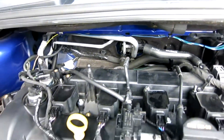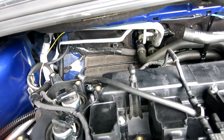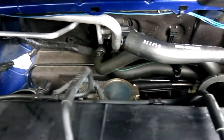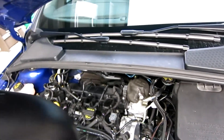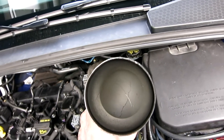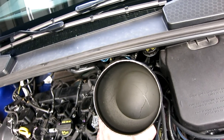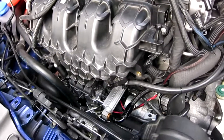A good thing to check is if you've got any oil in your intake. Oil in your intake is usually a sign of blow-by, and as you know, these motors like to break ring lands. So we pulled the intake off — there's the top of the GTX turbo — just to see if there's any traces of oil in it. And here it is, just going in, and it's a nice clear day: you can see there's absolutely no oil, meaning the engine is healthy, doing well with a solid Stratified tune with the auxiliary fuel system in place.